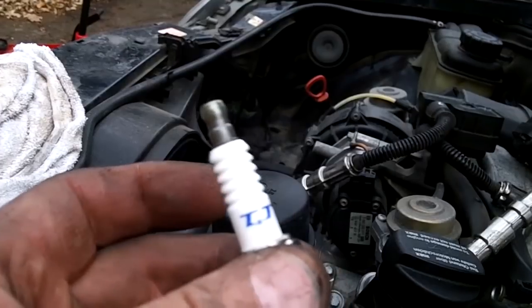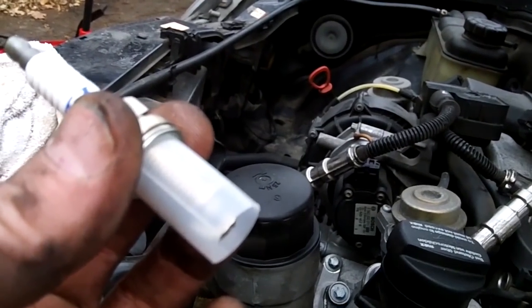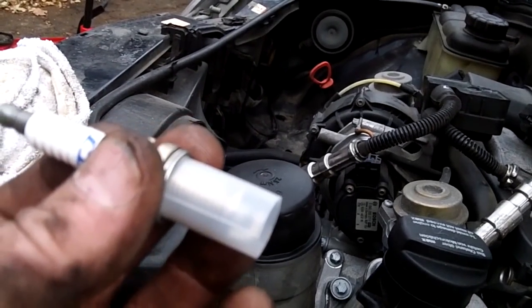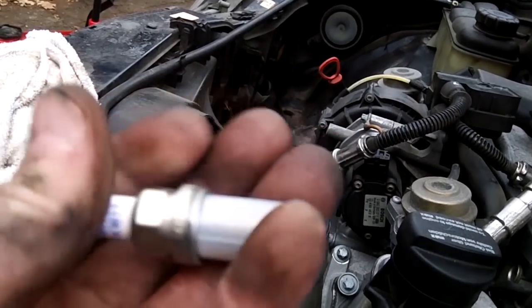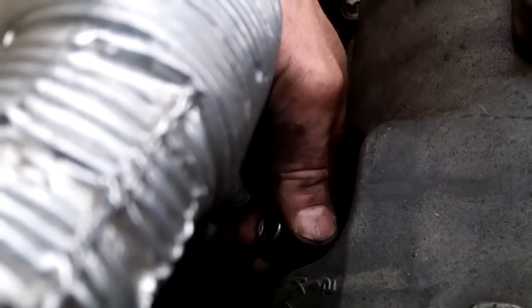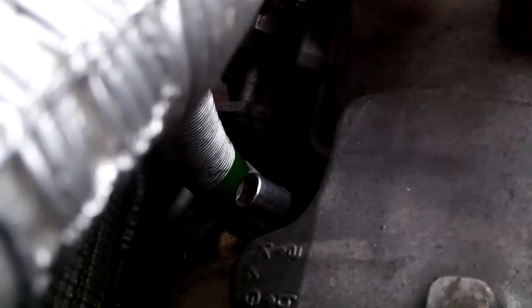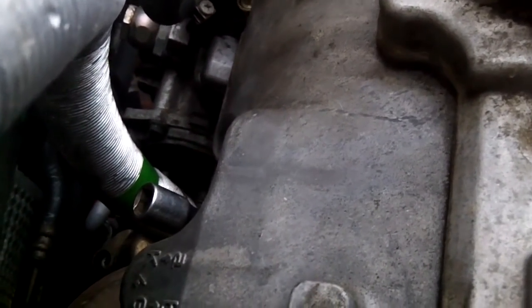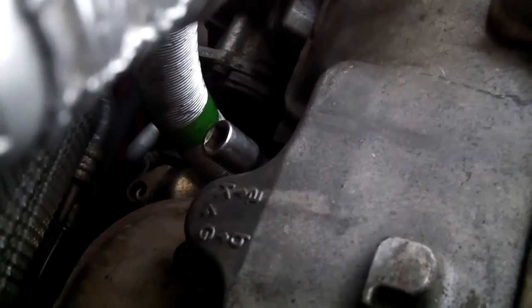Putting the plugs in is pretty simple — it's just a little tough to work your hands in there, especially if those plug wires have never been off. Never use a ratchet to initially torque the plugs in — always put them in by hand to make sure you're not cross-threading, because cross-threading means no fun. You can only do the final tightening with the wrench — 10 pound-feet of torque with a torque wrench, or grab the ratchet at the center and twist, which will generally give you about 10 to 12 pound-feet.